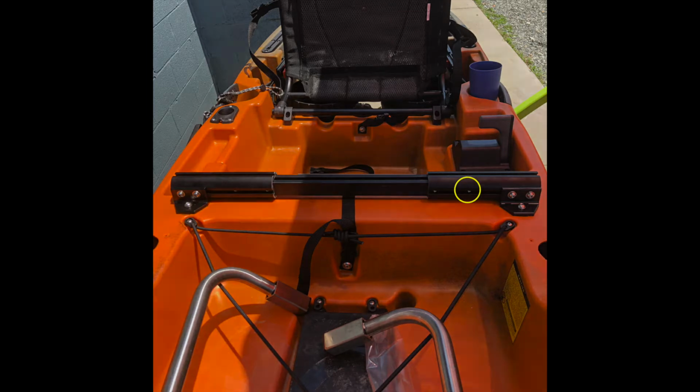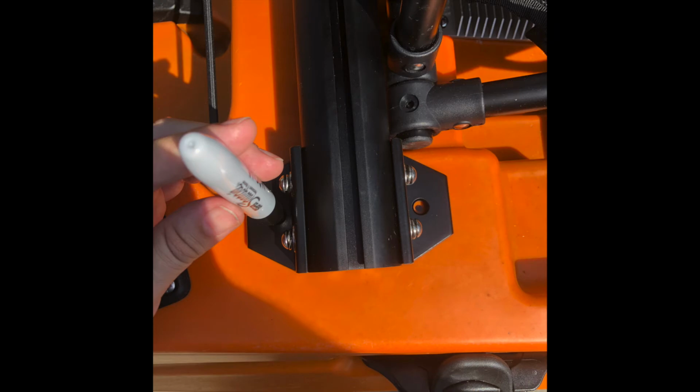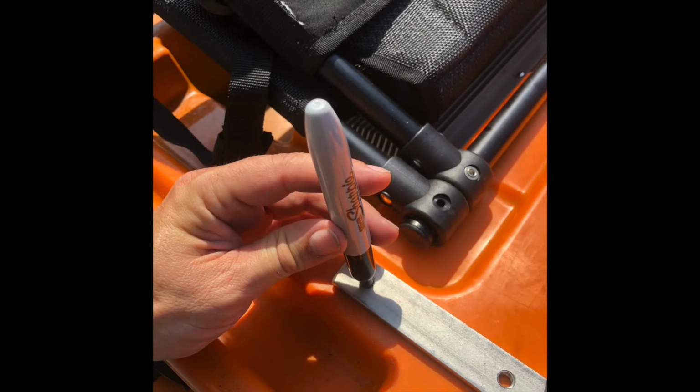Using a fixed even point such as the seat frame as a registration point, find the ideal location for your Groovy landing gear with the gussets in place and hand tight. Mark the 5/16 holes with a permanent marker. You can check these marks against your backing plates to ensure alignment and make extra marks on the ends of the plates if you choose.